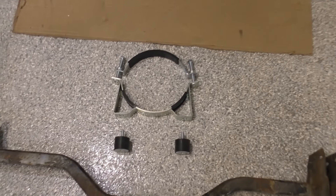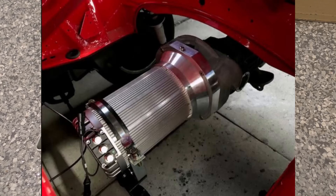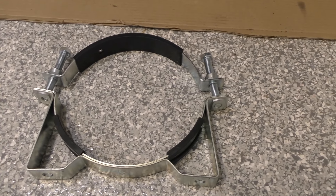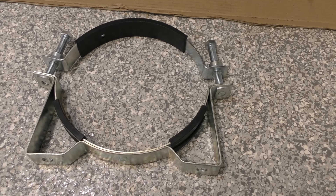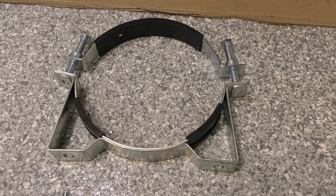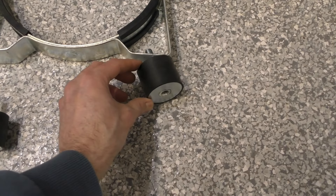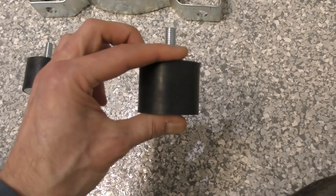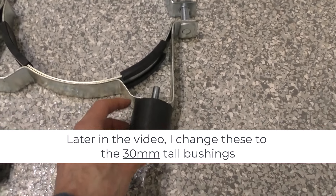These are the products we're going to be using. This is a motor strap made specifically for the Hyper 9 motor, which is the new AC version of Netgain's motor offerings, whereas mine is the old DC warp motor. Either way it's a 9-inch motor strap and it'll strap around my motor just the same. I'll have a link in the description to an EV parts seller — I actually bought this on eBay, so you can also use that as a search term. These are the bobbins or little shock mounts I'm going to use, 50 millimeters wide by 40 millimeters tall.